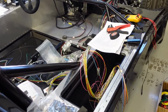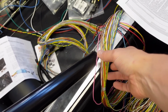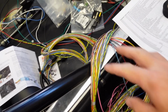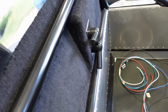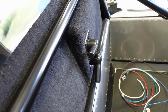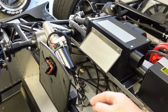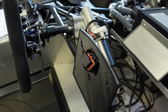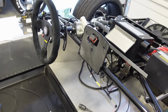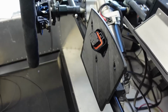Well done. All right, well, I'm neck deep in wiring here. I've got a bunch of things going on. I've got the main loom to the Motec PDM. Most of these wires are gonna be routing to my set of chassis plugs that goes into the engine bay there. And then I've got a bunch of other dash wiring. I've got my loom all made up for my C127 Motec display. So that'll be easy plug and play when that's ready to go.